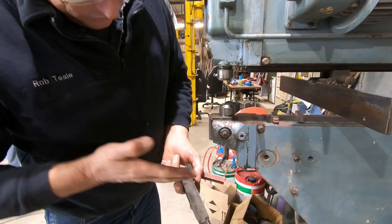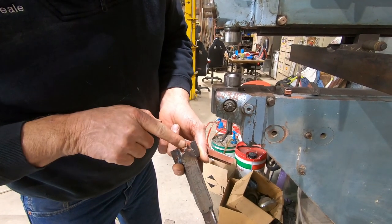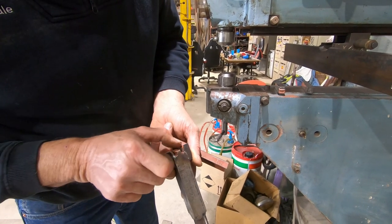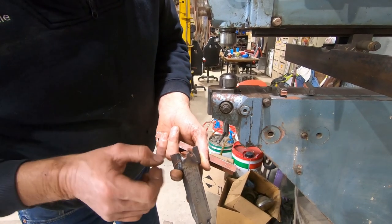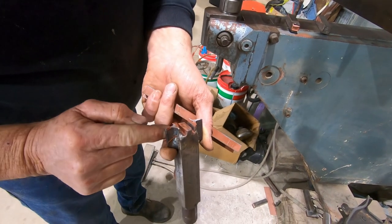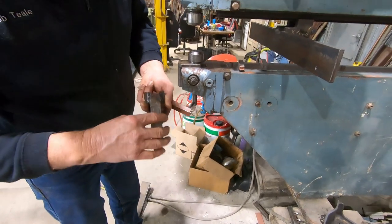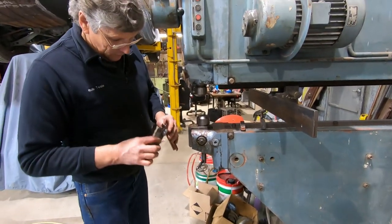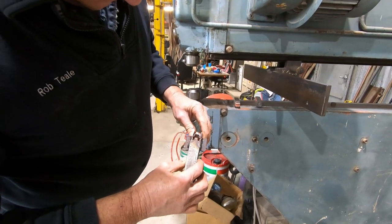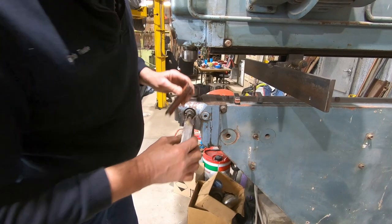So it's curled on the sides, and I made that by just grinding this shape in here, sitting it into the original frame, and then cutting some small pieces of flat bar, curling them a little bit, and then clamping them onto the original windscreen frame and putting some weld on there, and then I've reinforced these edges so they can't spread and come out. So we'll throw them in there, but you can see from this what it's going to do. It's going to catch that bulged out edge there and bring it down and bring it into a nice point once it runs through.